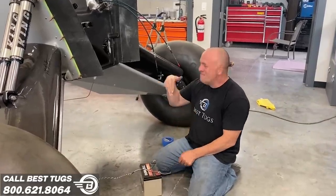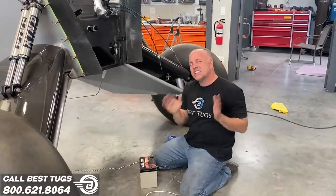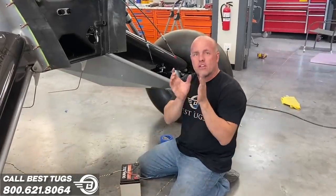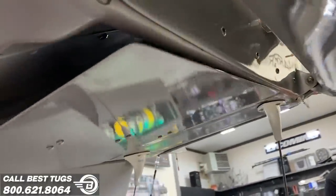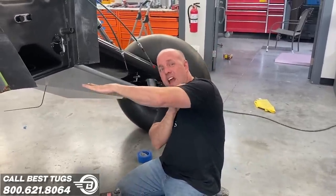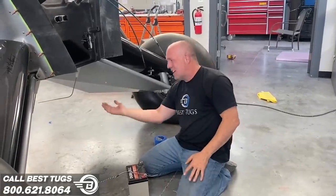The other thing I've done is when the cowl flap is fully closed, it's smooth, it's fast. But it actually never closes completely because I always want a little air movement going through there. It closes flat, but the ramp that's inside the plane carries just past it and leaves an opening for any high pressure to sneak out and still do cooling of the engine. The engine still has a side cooling, but I wanted more than the original. So even with the flap tight shut for the least amount of aerodynamic drag, there's still cooling air that can sneak out of it. But then I can carry it to whatever level I need.